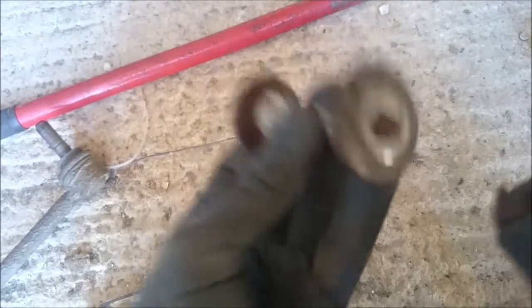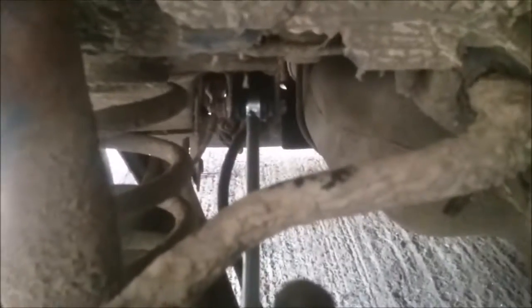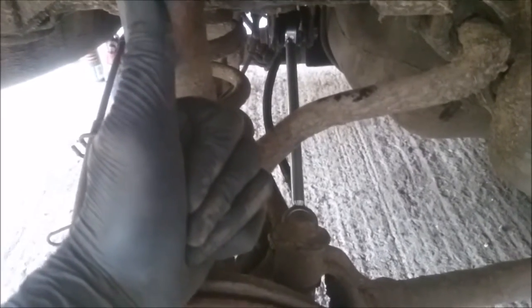There it is — she's in. A few things to take care of if you're struggling at the back: try fitting it up first and then lean on that part of the drum to push the hub in and slot it in. Note this was a 19mm, not an 18mm like the old one was. I've lined up all the marks, but you'll want to go and get a four-wheel alignment to make sure everything on the back end is right before you put new tyres on and ruin them as well. Job done — thanks for watching, subscribe, like, share.